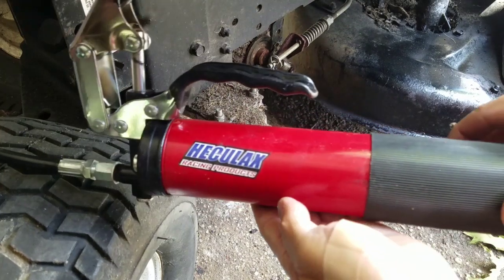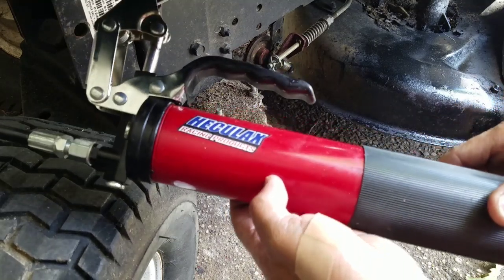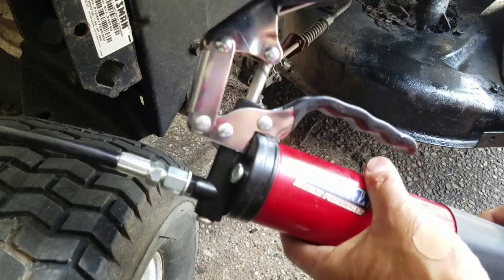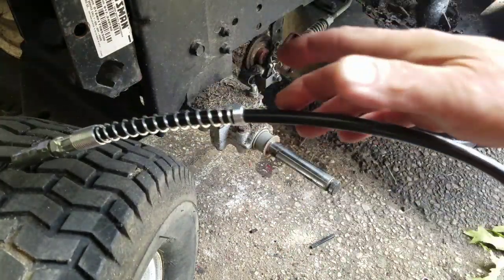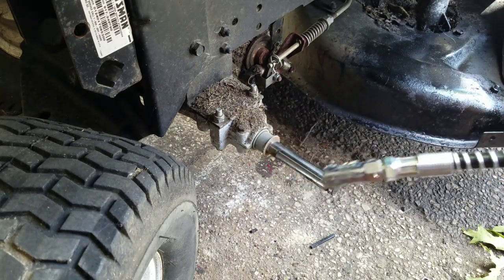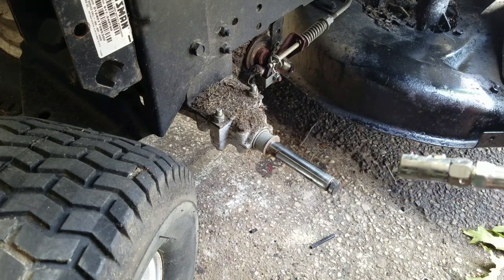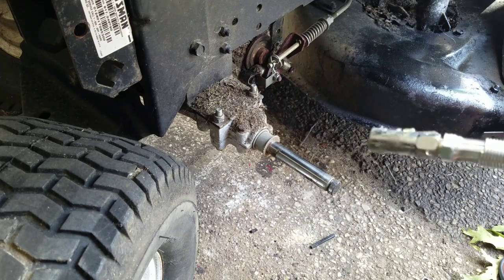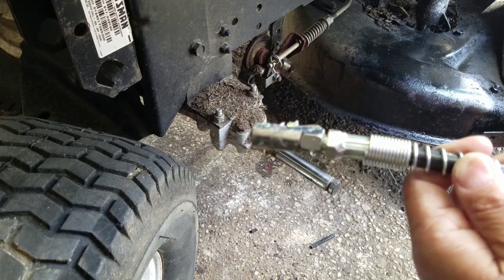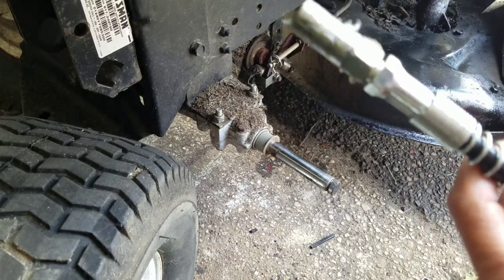Anyway, in the meantime, as you know, I finally figured out how to put a grease cartridge into this grease gun that my buddy Doug Leap from Doug's Mowers and Blowers from Altoona, Pennsylvania sent me. I actually used it for the first time the other day, and I put some grease in the front, not the axle, the front for the steering. The two grease fittings on the pivot for the steering. It seems to work great. I kept on pumping and pumping until some grease on the bottom started coming out, so I know it was full. Works fantastic.